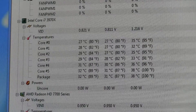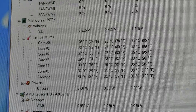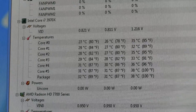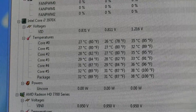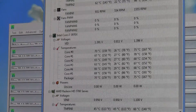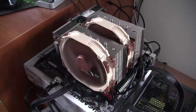We start off with stock values for our 3970X and idle temperatures. Nothing unexpected — the NH-D15 is better than the NH-U12S by a couple of degrees. While idling, both fans are working at a very low and almost inaudible 550 RPMs. Moving to the Prime 95 load testing, core temperatures are as low as 63–64°C for some cores and up to 70–72°C for the hottest ones, all while staying quiet at around 930 RPMs for both fans.